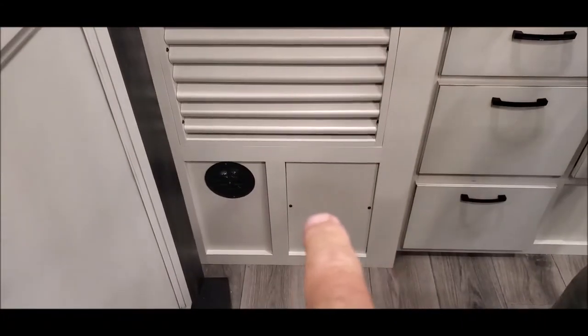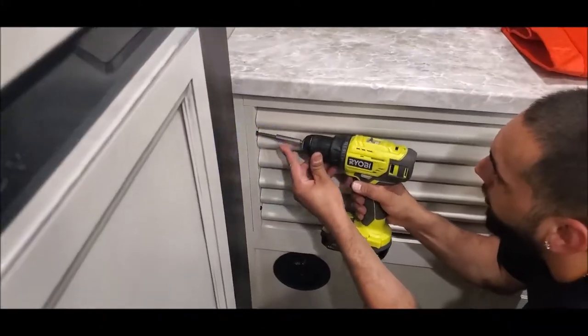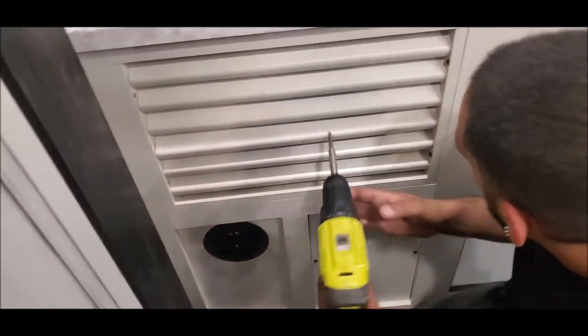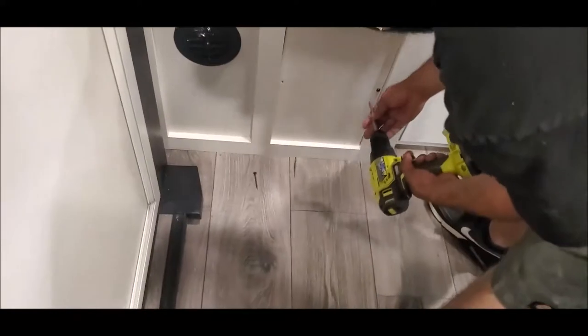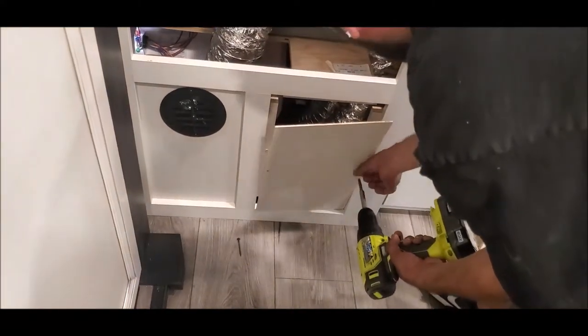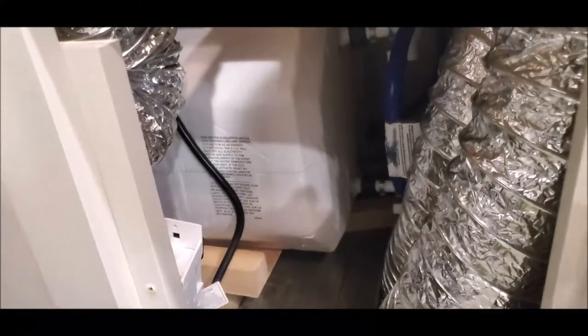Here's my refrigerator and here's the access panel. You'll see one here and one here, and we're going to take the four screws off the top. This gets us access to the back, which also has the power and everything behind it — we're going to put our control panel right there. We pulled one off — you can see my other heater unit there — and this gives us access to the bottom for our gas unit. This gives us access to the back. Pull them out of the way and you'll see: there's your water heater right there, and there's your connections right there in the back. We're going to pull it out the front, but first we have to disconnect it from the back.